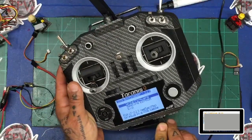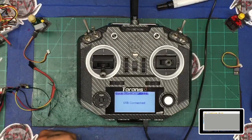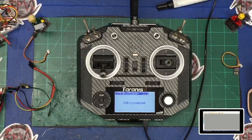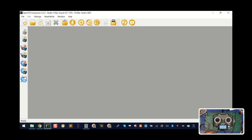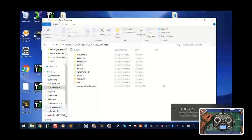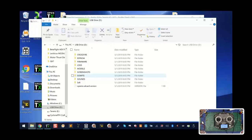When you see that screen, plug in your USB cable. You'll hear Windows pick it up and it automatically detects it. If you have any problems with your drivers, let me know. The computer is also going to read that you have an SD card inside. Wait until you see that pop-up — that means it sees your drives. My SD card drive already has all the software on it, so you've got your card contents folder sitting right there.